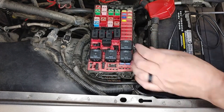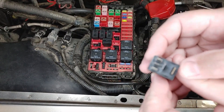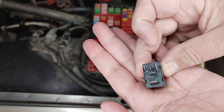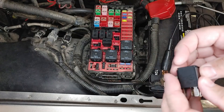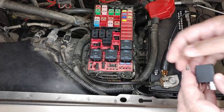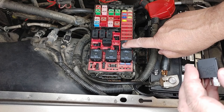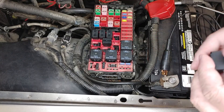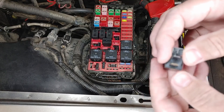I'm going to pull this relay — I've already got it out. It is what we call a micro relay and this is a 5-pin. On the bottom there we've got several pins. We've got a wiring diagram on the side. On the mini relays they are numbered 30, 87, 85, and 86. 85 and 86 is the coil wires where you test — where you apply power to. 30 and 87 is where it clicks and actually applies power or current to whatever you're controlling with the relay.